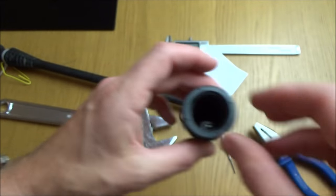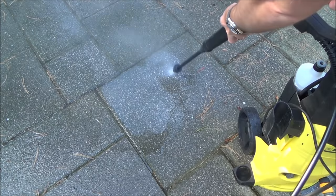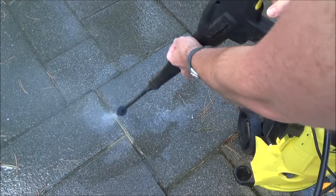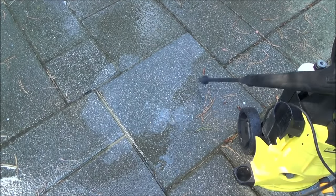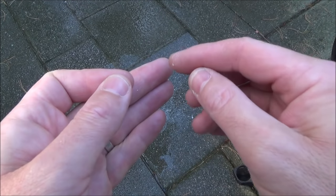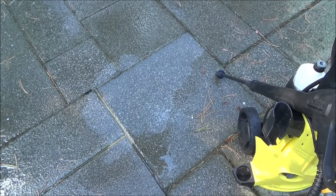The washer we used measures 6.1 millimeters across, 2.6 millimeters internal diameter, and 0.5 millimeters depth. To make it perfect, a depth of about 0.7 would probably be best. You can still pull the nozzle out a little bit if needed. Let's put it back together and show it working. It's working pretty well - all for the sake of a tiny little washer. It was nice to actually prove the fault rather than just trial and error. The ball bearing being constantly moved was wearing the plastic underneath, and putting the washer in just builds it back up to the correct height. Hopefully you enjoyed this video - please give it a thumbs up and subscribe for more trying-to-fix videos.